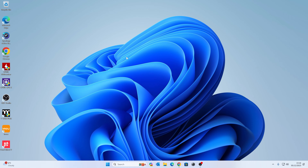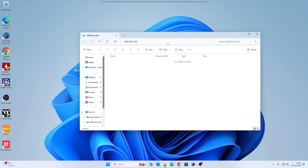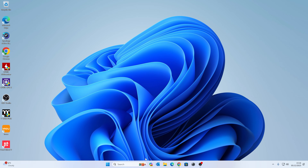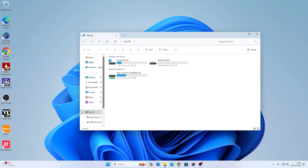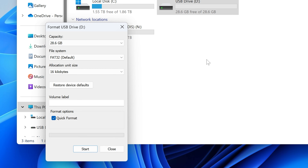We're on our Windows 11 desktop, so I'm going to insert my USB flash drive. You can see this drive is completely blank — that's great. If you're not sure about the format, open up My Computer, right-click your USB drive, and choose Format. Make sure it's set to FAT32 with the allocation size at default. Remove anything in the volume label. Make sure the drive is under 32GB — if not, you'll need to create a smaller partition as mentioned earlier.